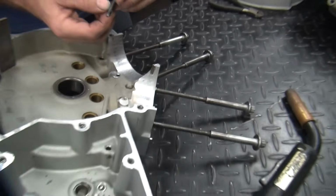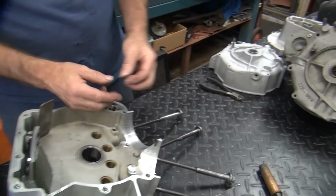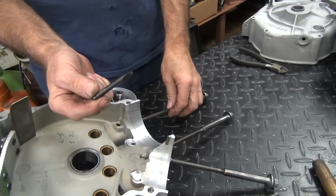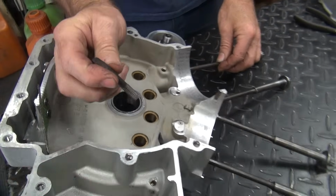So this is a big bore motor. They cut it all away. And for some reason, they thought they could torque that down to 18 foot-pounds and not break. Well, hang on, you're close enough. 18 foot-pounds on what, about a... It's a 5/16 bolt. So that means you got 18 foot-pounds, according to the book. Look how thin that is. Yeah. Maybe you shouldn't go by the book every time.